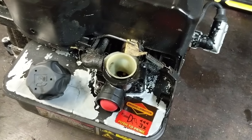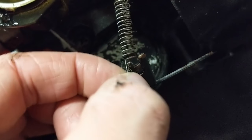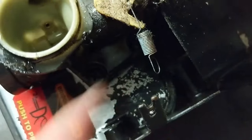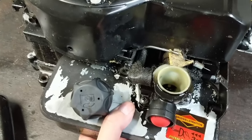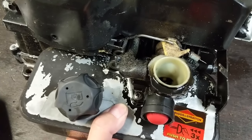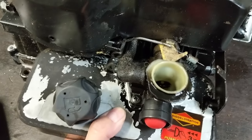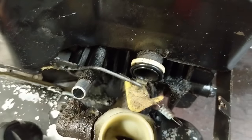Now that I have my bolts off I'm simply going to disconnect the spring — just go ahead and disconnect it, and try not to overstretch your spring when you're doing that. Now that the bolts are removed we can go ahead and gently start to pull the carburetor, just twisting it ever so slightly and we're going to pull the carburetor off of the intake manifold.